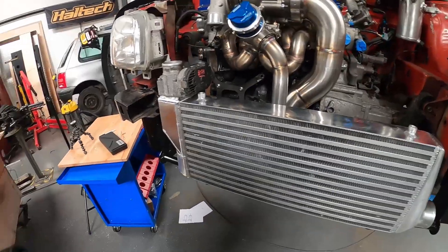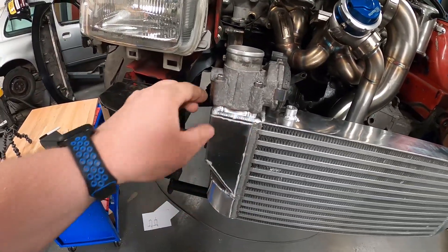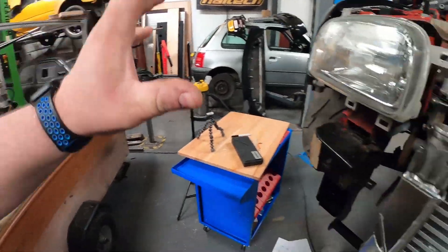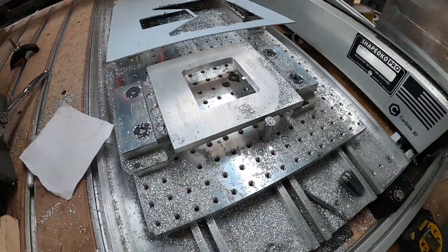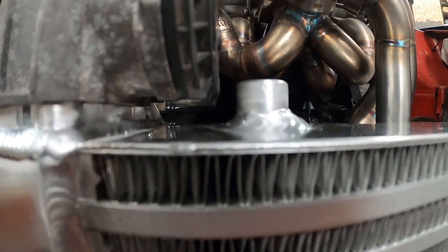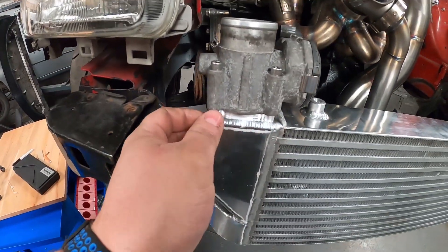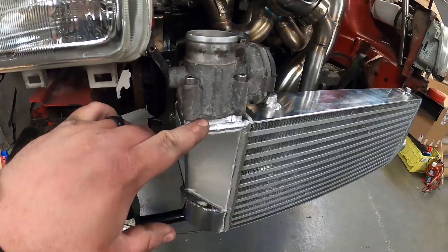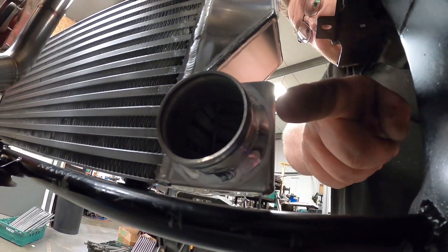That's come out as I expected — we've got a lovely bypass valve on there. We've got our flange machined up that we did on the little CNC. The CNC is an absolute godsend because we can design all the flat patterns and cut them out of sheet and alloy stock. We've got a bit of clearance there for the servo — probably a bit too much, but I wanted to make sure we had at least about 8mm of thread for the bolts. I also welded on a little barbed beaded section just there for the supercharger.